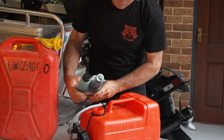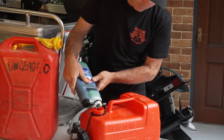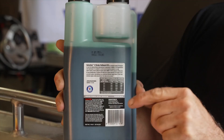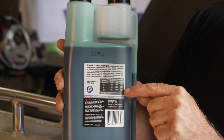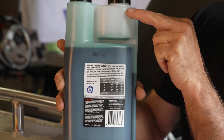The chamber pack is a great idea. What it does is help dispense the correct amount of oil required to obtain the perfect mixing ratio depending on the manufacturer's guidance. The measurement displayed on the back allows you to accurately dispense the exact amount of oil, and it's got little increments on the back that go right up to 100ml.